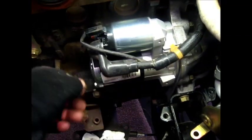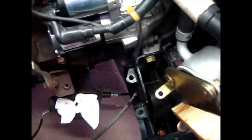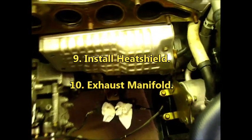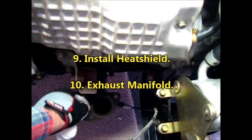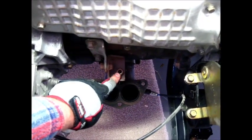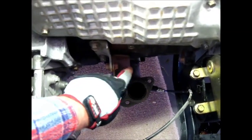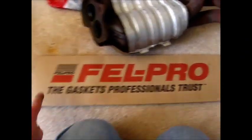I have installed the new starter, hooked up the cables and the other cable, and now I will start putting the rest of the car back together. So now I'm putting the heat shield back on. One item to take note of is that when you go to put the exhaust manifold back on, you'll see there are four screws. You'll want to screw this one in first because it's harder — that pipe gets in the way — then do the other three.